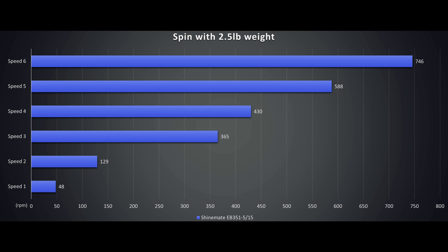At speed 1 to 2 we can't do much with anything under 150 RPM — maybe just enough for applying waxes, which is fine. At speed 3 to 4 we can comfortably and efficiently do light corrections. And 5 and 6 is where cutting happens, especially speed 6 — you can really feel the power come in.